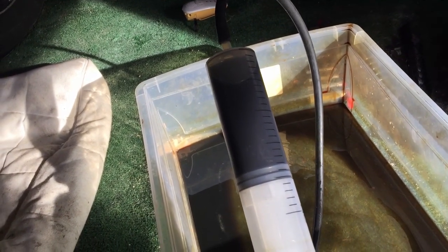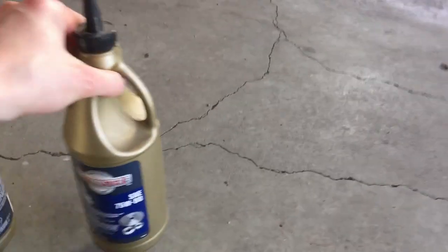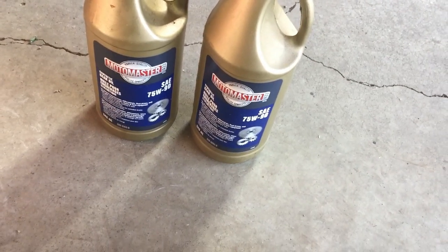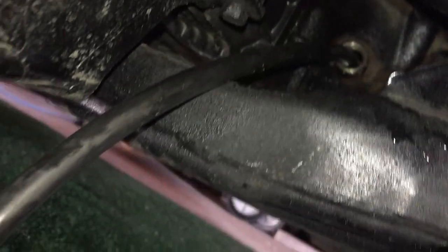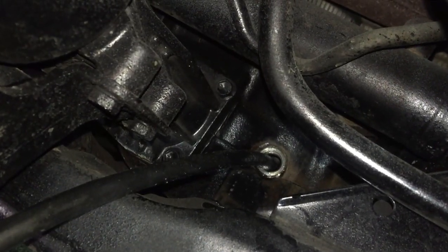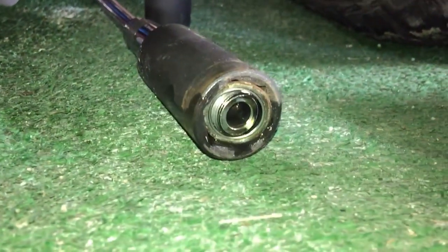I'm going to load the syringe with clean fluid and push it in — I'll need probably two full syringes. The new oil is a synthetic gear oil from Motomaster, 75W90. The syringe is loaded — I filled it from the back and closed the piston. You can see it's completely transparent, as it should be, unlike the old fluid. I put the hose in and press it all in until it starts flowing from the hole. When it starts flowing from the hole, you're done — as easy as that.